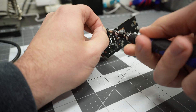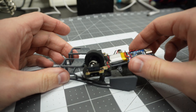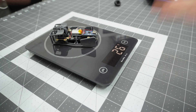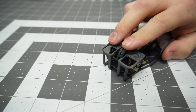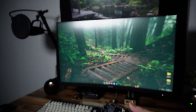Just like in my original design, the mouse button switches just get screwed to the main board using these 3D-printed switch mounts, which have also been modified from the original to be a bit lighter. Not only did we beat the goal of getting it under 30 grams, but it still stays true to the original design in that it doesn't need any extra hardware other than what comes with the G305 — such as the screws, switches, and even the skates, which I removed using a little bit of heat to preserve the adhesive. Of course, that's with the exception of the LiPo battery.